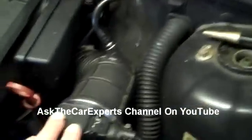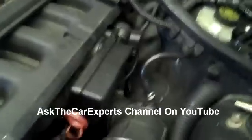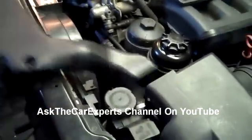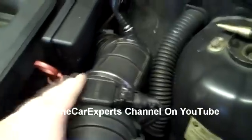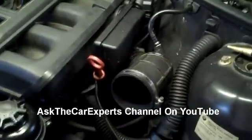Now the best place to do a smoke test is after the mass air flow sensor. So I'm going to pop this off — you want to give me a hand? I need you to pull that piece right off, right there. Just go ahead and grab it and pull it right off. Thank you, Tom. Now we want to remove the engine air filter. I already have the two hold-downs off and this loose right here. I'm going to pop that off, push down here, and disconnect my mass air flow sensor. Now we have access to do our smoke test.